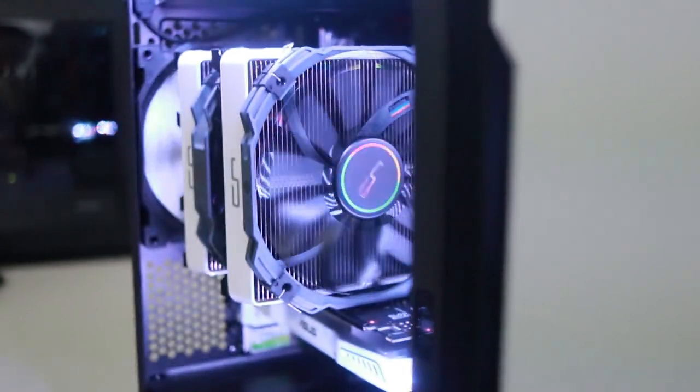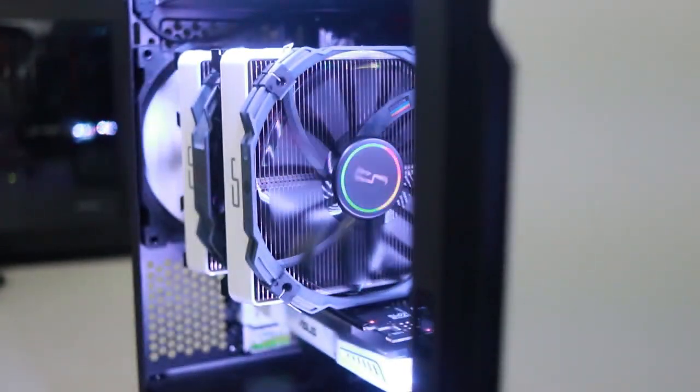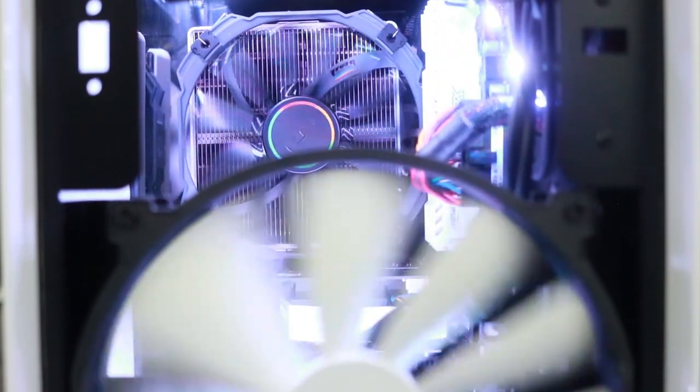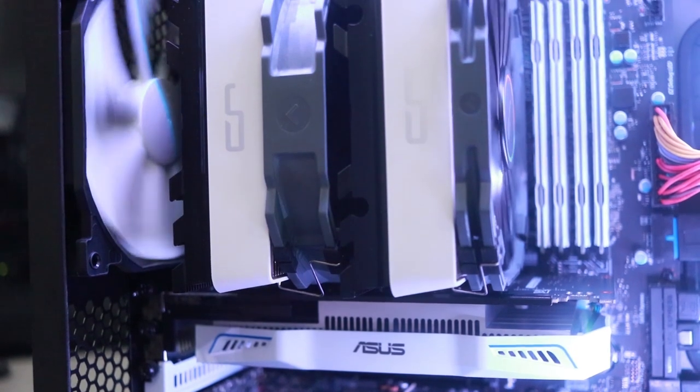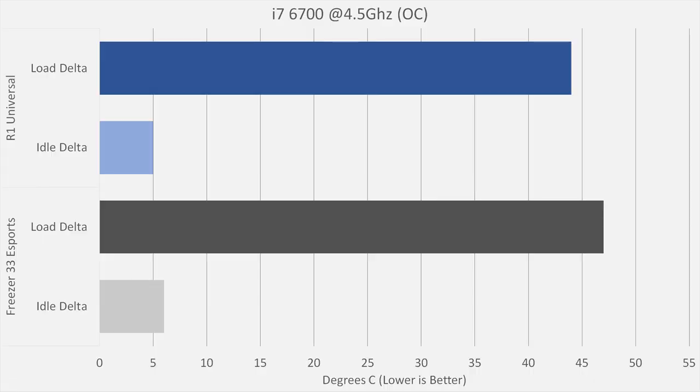Of course it's unlocked, so we're able to overclock it to that frequency. It runs a little bit toasty being overclocked and, of course, with the voltage increased accordingly. For that reason, we have a CryoRig R1 Universal sitting on there, which is one of the biggest air coolers out there. On the overclocked 6700K, the Freezer 33 eSports sat at a chilly 32 degrees Celsius, which was only 6 degrees warmer than the surrounding temperatures. At load, the cooler managed to keep the processor at 73 degrees, which was also only 47 degrees warmer than ambient temperatures.